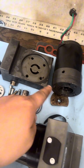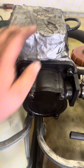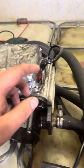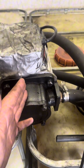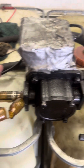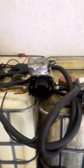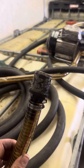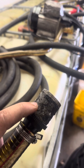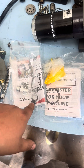My pump I use to go pick up raw motor oil uses the same kind of pump as their system — it's the same type of ring gear pump. I've been using it for over six years. It has a bigger 120-volt AC electric motor and can pump 100 PSI at 20 gallons per minute of straight gear oil, which is what it was designed for. Over the years picking up raw motor oil and transferring oil between totes, I've probably pumped over 40,000 gallons with that pump, and all it has is a screen on the end — so all kinds of dirt and grass and stuff has gone through it and it's still working to this day.